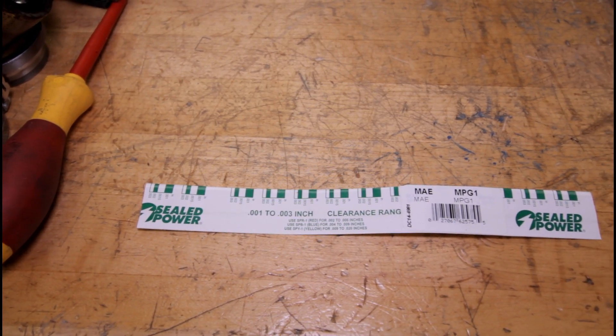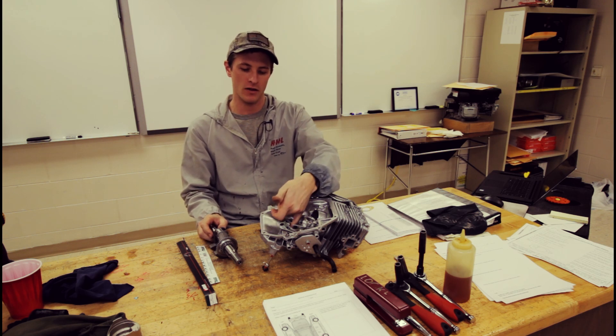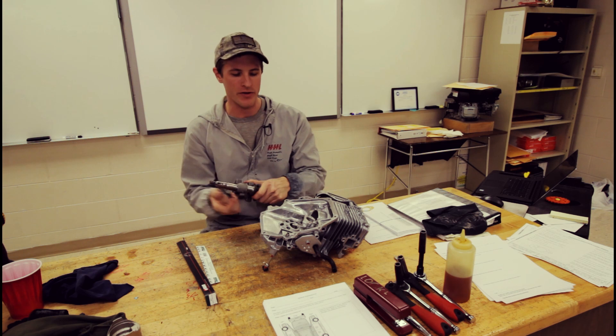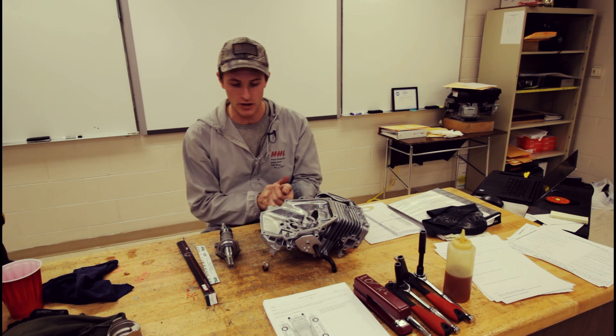This tool — being a piece of wax inside a piece of paper — is only going to work on clamp-together type of bearings. Like the one in the block up here where these pieces slide, it's not going to work on those. It's pretty good for your main bearings in car engines. I use it a lot for that and I have good luck with it.